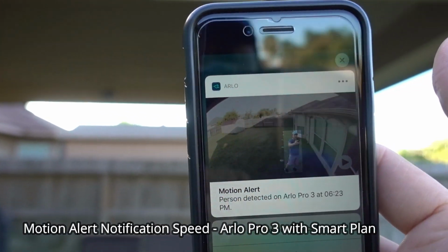Right there. Please note that if you're subscribed to Arlo Smart Plans, your notifications will be delayed, just because the initial motion event needs to be uploaded to Arlo servers so that their AI can process it and determine if it is human, animal, cars, or other motion. And you will get notified depending on what you set up. If you're not subscribed, like the Arlo users that are on the 7-day free cloud recordings, then you will get the notification within 2 to 5 seconds.